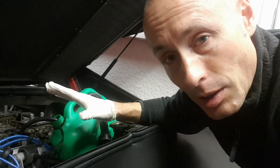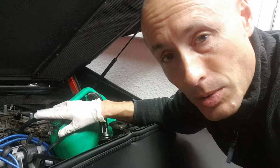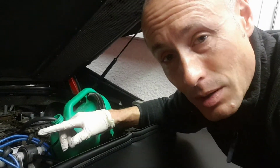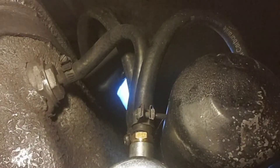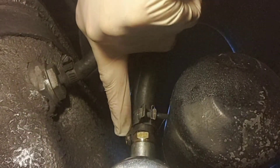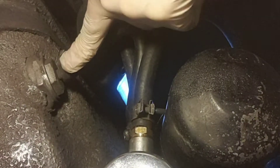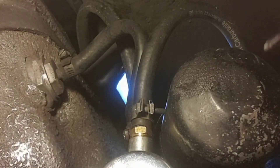Although there's probably still a little bit in there, I think it's safe now to undo the pipe at the bottom. The fuel was coming through pretty clean, so I'm not sure there's even anything wrong with that pipe, but now it's empty and I've replaced the filter and the pump, it makes sense to just do that pipe too — make sure everything is good. The tank's drained out now. The piece of pipe I've got to replace is this one here, coming from the junction on top of the filter — quite a short run just around to here. I've pre-cut a piece of pipe already, so let's get this one out and get the swap done.